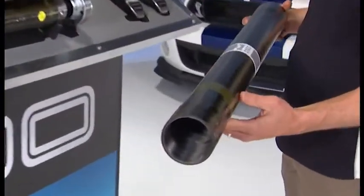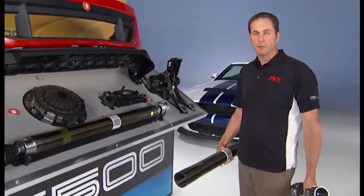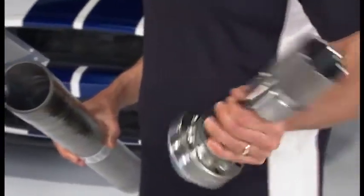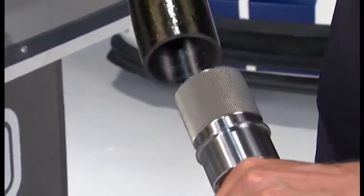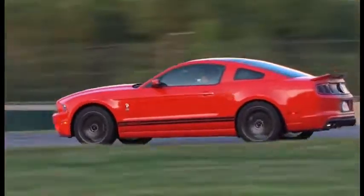The light weight contributes twofold: it lowers the weight of the vehicle as well as the inertia weight, which allows the driveline to spin up. One challenge on a carbon fiber drive shaft is the interface to the transmission or the axle side. So you usually have a metal yoke and what we've done unique on this vehicle is we machine these splines and press them into the carbon fiber drive shaft. There's no adhesives. That bond is amazingly strong and can handle all the torque and all the heat you can throw at it.